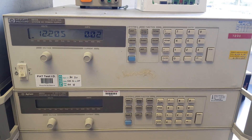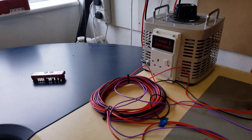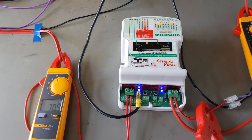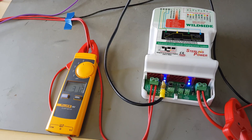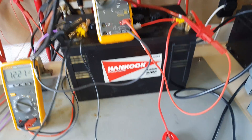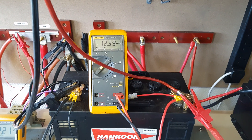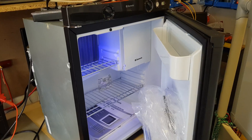This test involves the Wild Side battery-to-battery charger. I've turned on the power supply at 12.2 volts, going along the same cable as before — the same 2.5mm² cable — running directly into the battery-to-battery charger. One line is the connection from the starter battery and the other is the direct line from the fridge connection input. Going through the battery-to-battery charger and outputting to the domestic battery, we are currently putting 8 amps into the domestic battery. The domestic battery's voltage is climbing — a net charge onto the domestic battery — and simultaneously we are running the fridge, which is also engaged and operational.